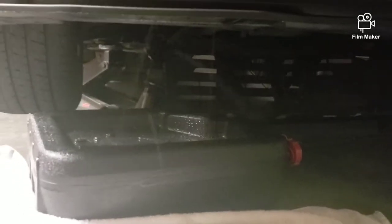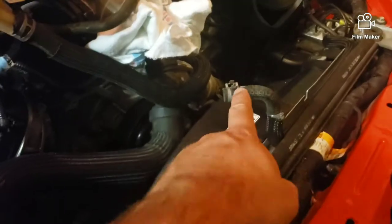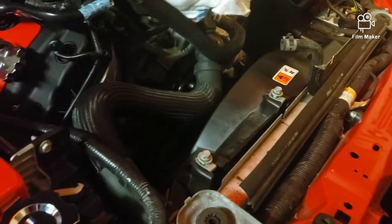I'm using the drainage valve but it's making a mess — this little drain pan is not big enough, coolant is splashing all over the floor. I'm going to wipe this up so my dog doesn't come in and lick it, then wait for it to finish draining. First we empty the radiator, then we start disconnecting hoses. I detached the coolant overflow hose that goes to the radiator and took the tank off the fan shroud, wrapping a bungee around it and pinning it to the strut brace.